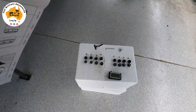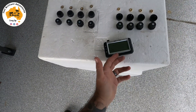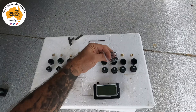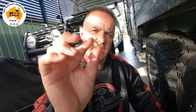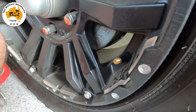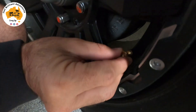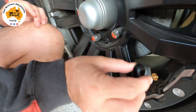I've got everything laid out here in front of me — you've got the eight gauges, the monitor, a couple of tools we'll be using, and some spare rubber grommet seals that we can use as needed. What we're going to do now is put one of the tyre pressure gauges onto the tyre. The first thing you're going to need is the locking nut. What this little nut does is: once you put it on the tyre and put the gauge on, you screw the nut back towards the gauge and it locks it in, just to stop people stealing your gauges. So we screw the nut on — make sure you don't cross-thread it — with our backing cap.